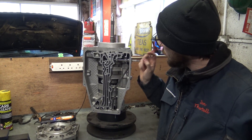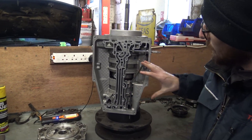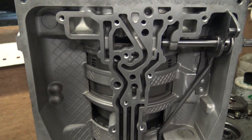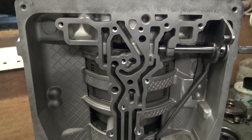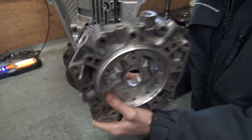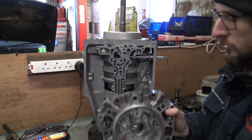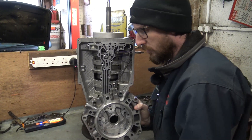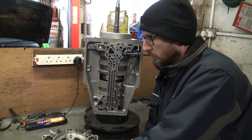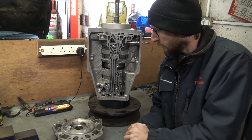Not complete yet obviously. All of the clutch housing and clutches and everything are now in — everything's lovely and clean, all new seals on the pistons. I'm now at the stage of cleaning the oil pump housing up, which is this part here. This sits between the bell housing and the gearbox, just on top here, and houses the oil pump. So I'll be inspecting the oil pump gears and everything — I've given them a pre-look and I'm pretty confident they're good gears, but I'll have a much closer look before I install them.